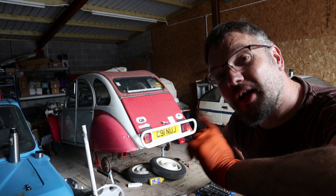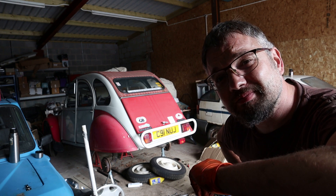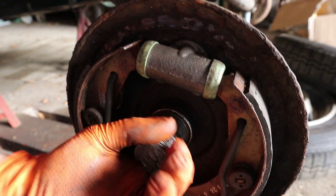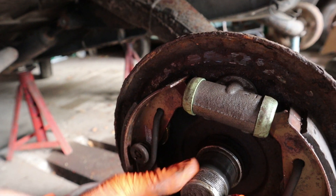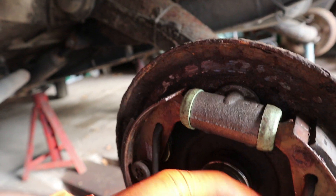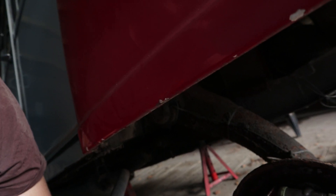At this point I remember I haven't fitted the little retaining clips that hold the shoe in place. I am an idiot. Sadly things have escalated in entirely the wrong way - the new nut didn't seem to feel very comfortable going on, and sure enough it wasn't. It's chewed the thread up on the stub axle. So now I'm screwed unless I can find a die to re-cut that thread. I'm really in trouble - I think this is the point where you walk away from the job. I'm going to go back home and ponder my own stupidity. Stay tuned and you'll see how I get out of this fine mess.